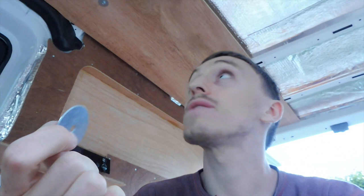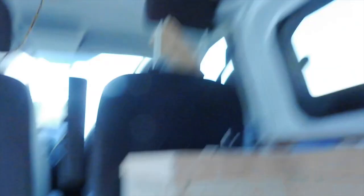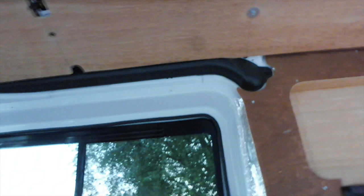What I did was, where the holes were meant to be, I drilled a 22mm hole using a 22mm drill bit. The washers are much bigger than this, so it doesn't matter that the holes are way too big for the screws. I managed to get it pinned up with the help of my lovely girlfriend — got the first one in place, the other one rested on top of the headrest. Once the two back ones were mounted, I used a long piece of old flooring to push up against the roof to get that extra couple of millimetres needed to get the nut on. Now we are cooking on gas.